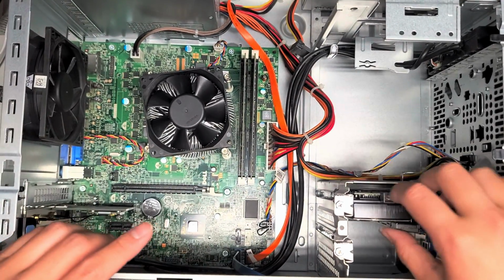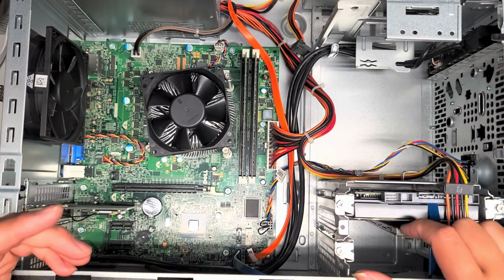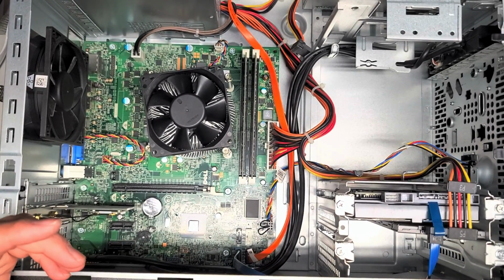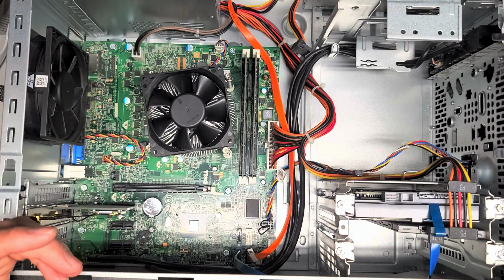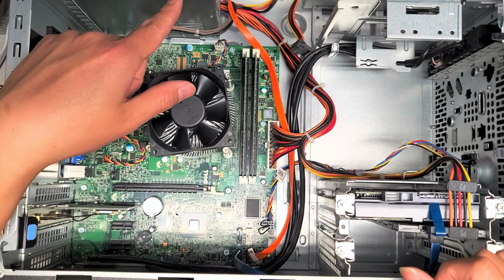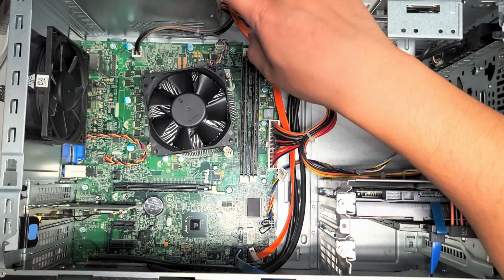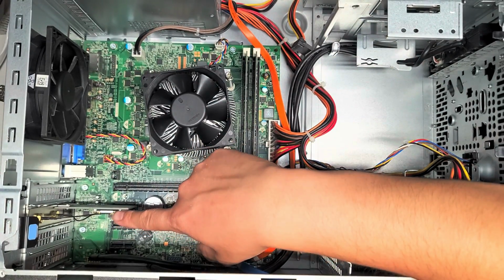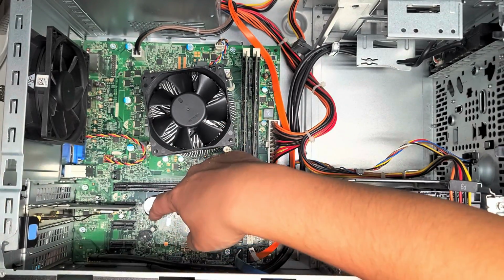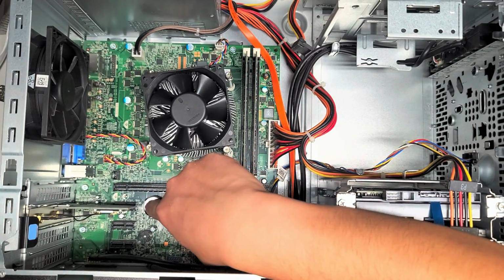That's pretty much all I'm going to show. I just wanted to show how you can add an SSD in here. You can also buy a 2.5 inch to 3.5 inch adapter bracket if you really want to mount it securely, but it doesn't really have any issues just hanging around in there. The power supply is replaceable, since it uses a regular ATX power supply, which is a very standard desktop power supply. The wireless card is a laptop wireless card mounted on this board. The CMOS battery has a spring-loaded push clip that you pull down, and then the battery can pop out.